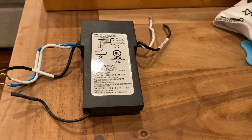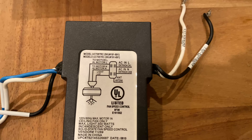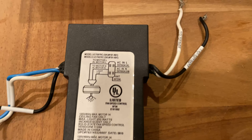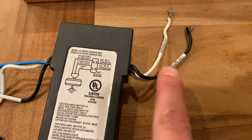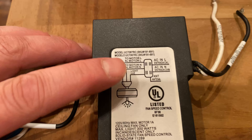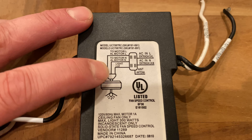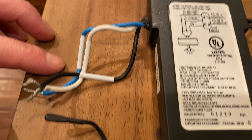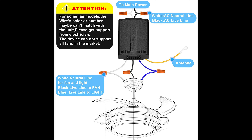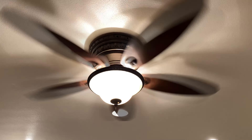To get started, let's take a look at the module that's currently inside the ceiling fan. This is what's going to be inside most of these fans. This control speaks to the remote mounted on the wall — it allows the fan to turn on and off, go three different speeds, and turns the light on. Once you open up your fan, you'll find this control box, then take your new control box with Wi-Fi capability and swap the wires identically. I suggest taking a picture so you know what color goes where. I'll put up a diagram here to help you — the new Wi-Fi box is identical to the last one as far as wiring, so just match up the existing wires.